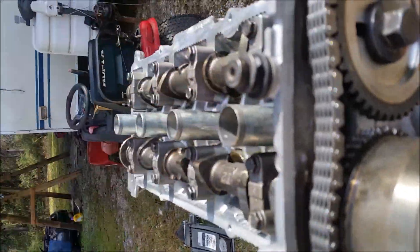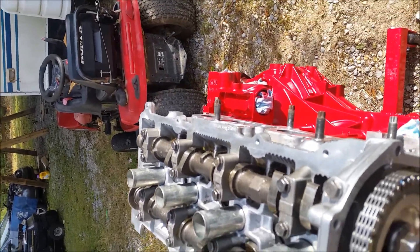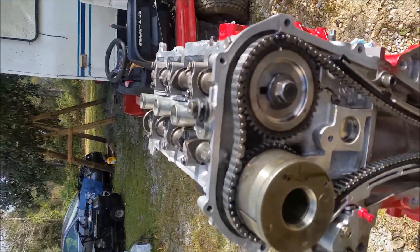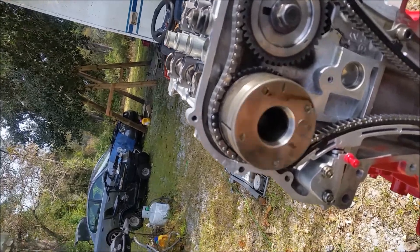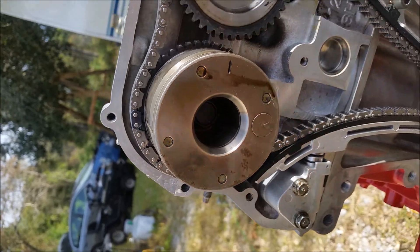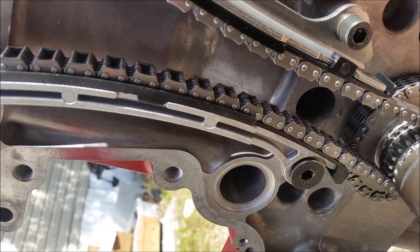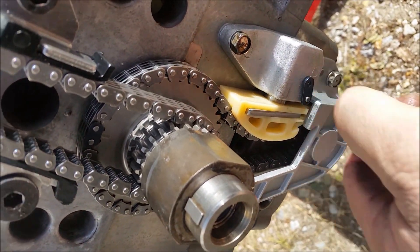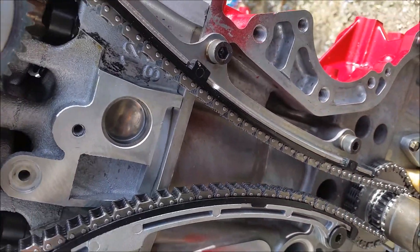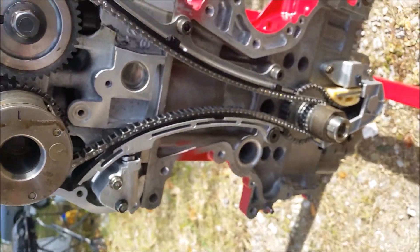You can actually turn it and pop that back out, but the camshaft — because of the way it's sitting on the valve springs — wants to return back to its natural position. So that's how it goes. Pull these pins out now that everything's set for the tensioner; that'll allow the tensioners to operate and tension up the chain properly. The next thing we're going to do is put the front cover on, and we're almost done with this motor.